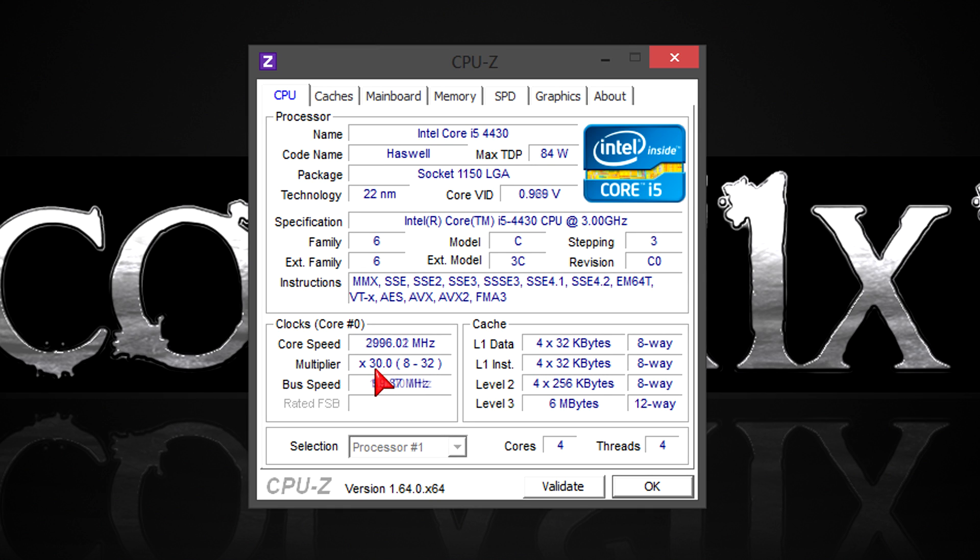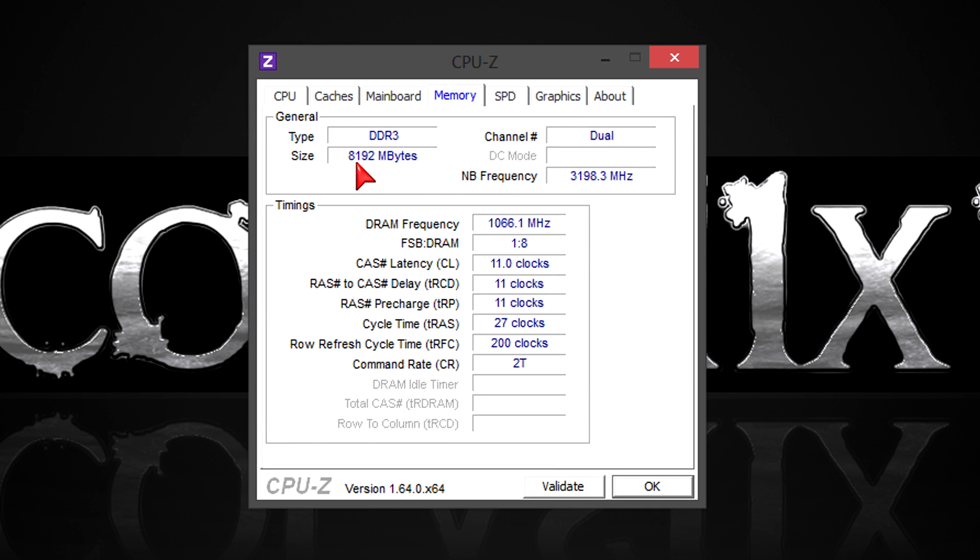There still is a possibility to overclock, but not an easy one. I have DDR3-2133MHz memory installed. Just like Ivy Bridge, the new Haswell CPUs in general have no problem with high-frequency memory. Unfortunately, this i5-4430 isn't able to keep the DRAM frequency at a stable value and the frequency can dip from time to time, which is really strange. The i5-3450 Ivy Bridge also had problems with DRAM frequency. So if you have memory running higher than 1600 or 1866MHz, I'd recommend going for the next higher model, the i5-4570 — but only if you really care about DRAM frequency stability.